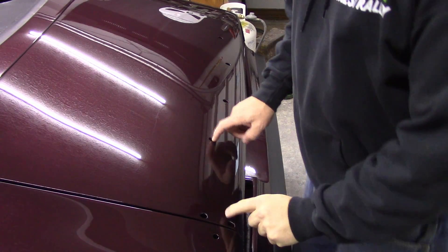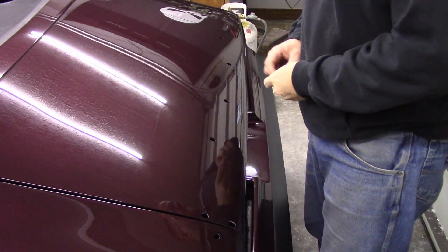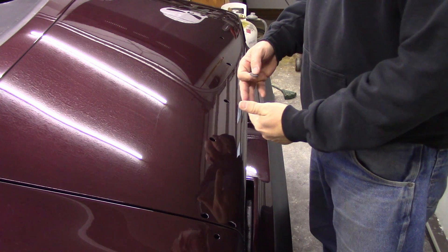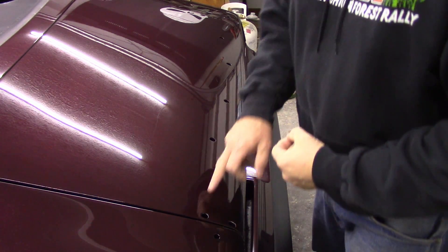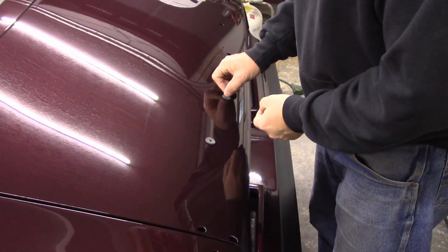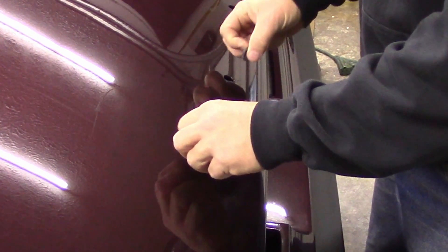Just a reminder: this deck lid as well as the rear quarters — this car was not a Trans Am or Formula ordered with the spoiler. So I had to make a template based off of the end pieces and the center piece to figure out where to put my holes. I was pretty worried about the size of these holes. I had to oblong a couple of them, but it seems like these washers really fit and cover all the holes without even having to squish them down.